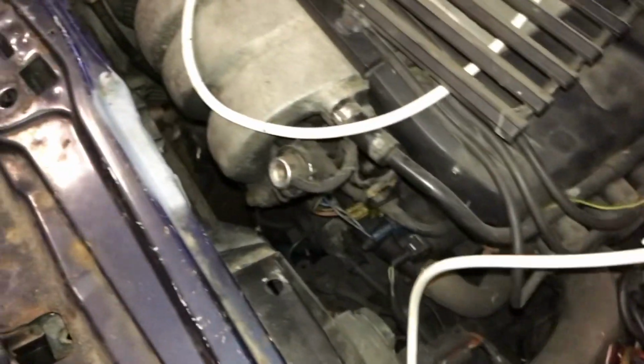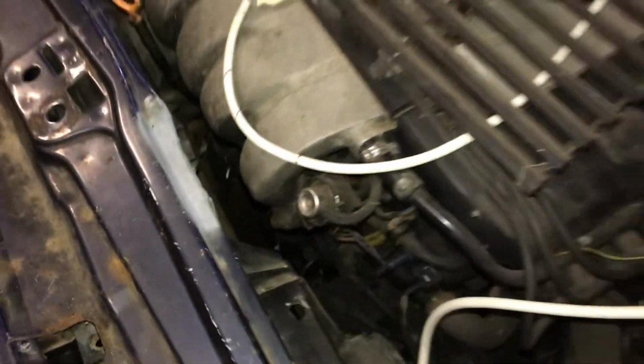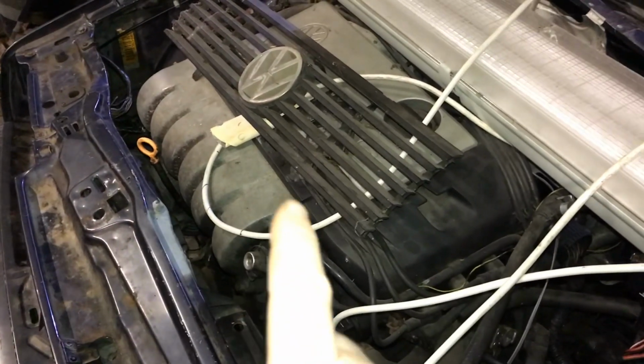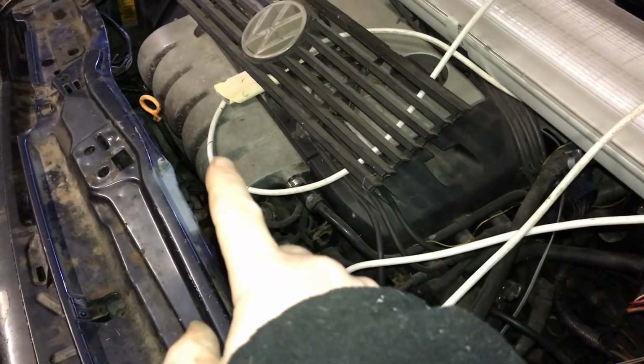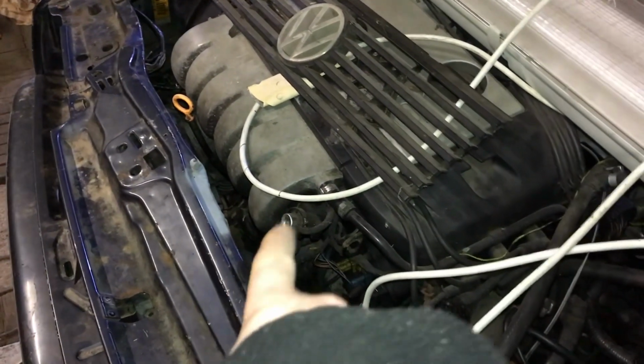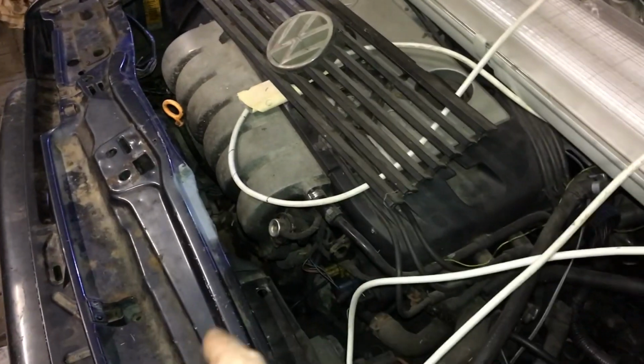Okay, here we are at the front. Yes, there is a pressure regulator valve just here on the front of the engine, and you can actually run 9 bar, and that pressure regulator will drop the pressure to 3 bar, because it'll only let in 3 bar and send the other 6 bar somewhere else.